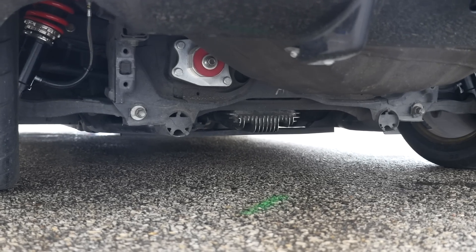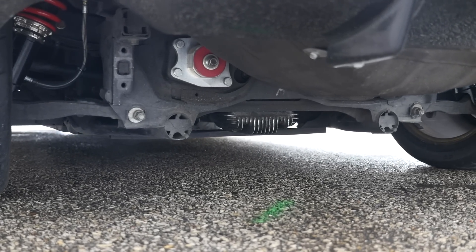Let's talk about the rest of the drivetrain — getting that power to the rear wheels is key, and I'm pretty sure the stock six speed Honda box was never going to handle that. I tried hiding from reality and using the six speed for a while — it worked at 600 horsepower every once in a while. But now it's got a Quaife six speed sequential, the 69G model. It's got a Nissan R200 rear end from the 300Z and some Skyline models, a carbon main driveshaft, and DSS 5.9 axles.